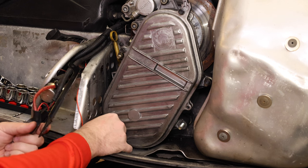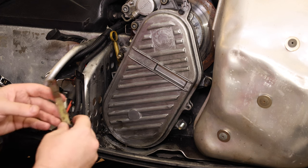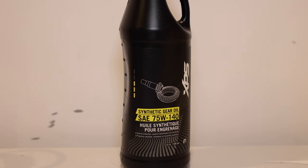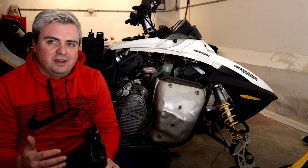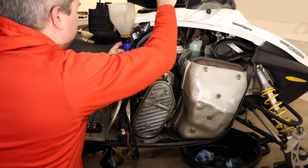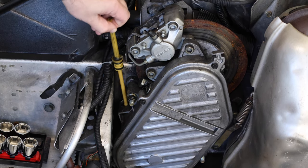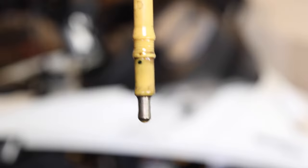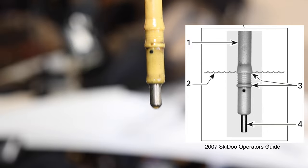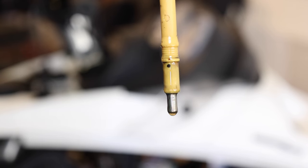Let's go ahead and get this back together and then we can refill it with oil. We'll get the correct amount in there and then check everything out. We're going to start with around six to eight ounces and see where we end up on the dipstick. Now we're going to go ahead and check the dipstick — let's pull it out. Looking at the dipstick, we can see that the oil is actually up above the low level and about right at the top. That's the location we're going to use to ensure that it's filled. So now I'll go ahead and put this back in.